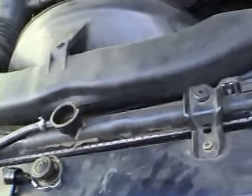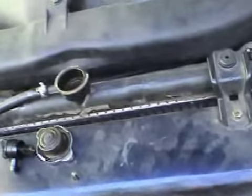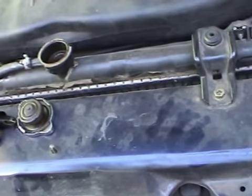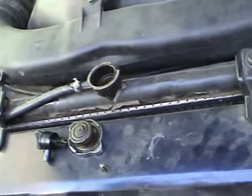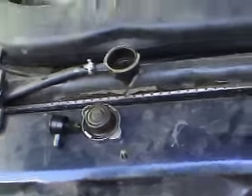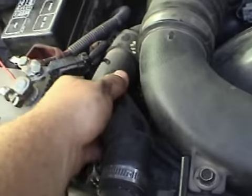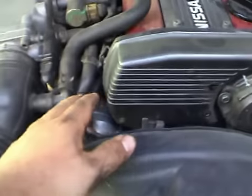They usually require you to put it in with some water, drive for 15 kilometers I think they say, or 5 minutes, and then you drop that stuff out, and then you put in your coolant. It's supposed to clean all the coolant out of your engine, because there'll be coolant inside the engine. Inside these pipes there'll be bits of coolant inside the engine.